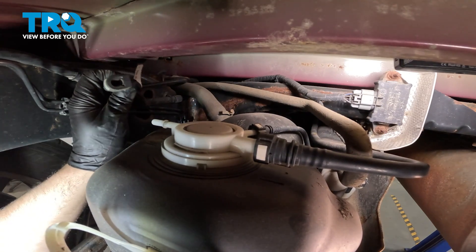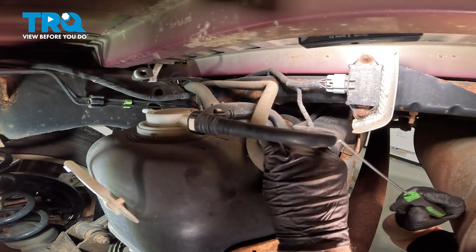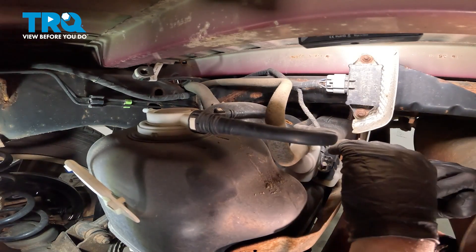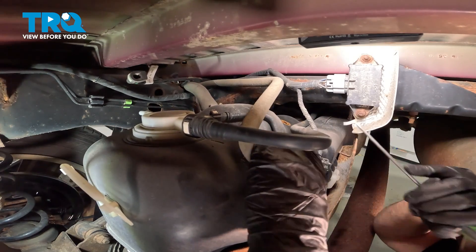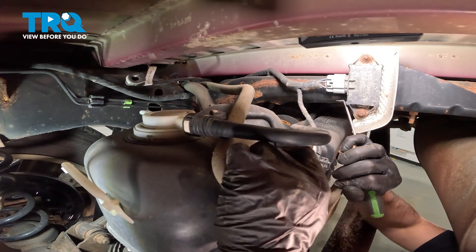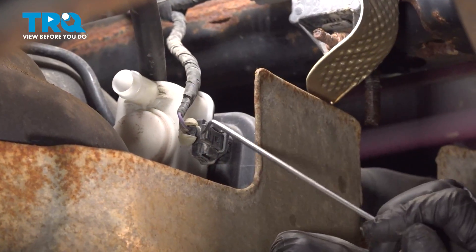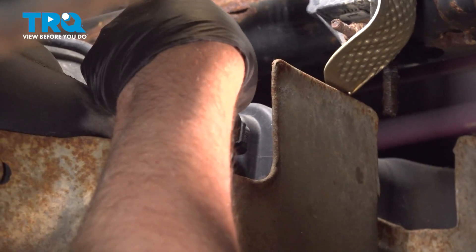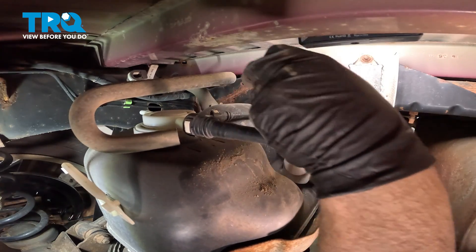The lock fell off, that's okay, put that on later. There's a hose right here. We're gonna disconnect that hose. I'm just gonna use a pick, just get underneath here, loosen that up. Slide that hose off, out of the way. Now I'll disconnect this connector. Just push down on the tab. Slide that off.